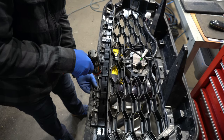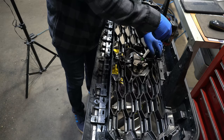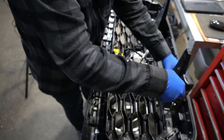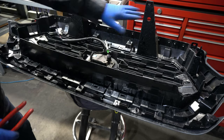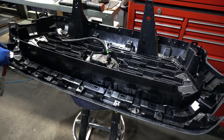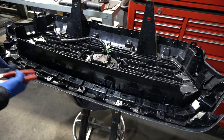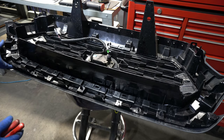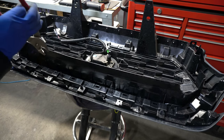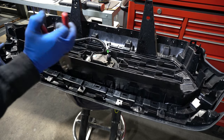Just wanted to quickly show this part and correct myself — all these outer perimeter screws you actually don't need to remove. You only need to remove the ones around the center. In order to separate these two pieces we have all those clips that we have to undo. Find a place where you can get some pressure. I got my hand underneath applying a little bit of pressure — not enough to break it. You got to be careful. Just lightly applying pressure to the tabs and squeezing them and popping them as I go along.